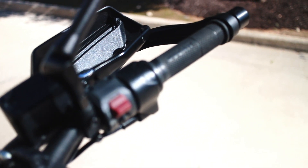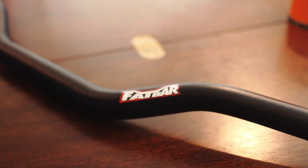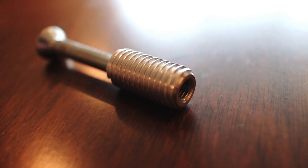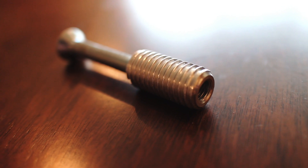I've ridden it a couple times with these bars on. The switch mounting area is only 200mm. Renthal makes a bar with a 222mm switch mount, so we're actually gonna swap these out. In addition to the Renthals, I also decided to get some threaded bar end inserts — honestly, these are just a must-have upgrade for almost any bike.